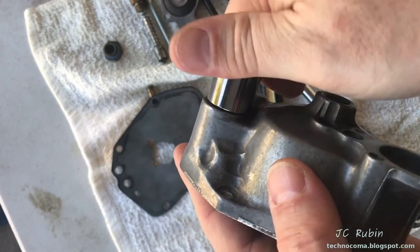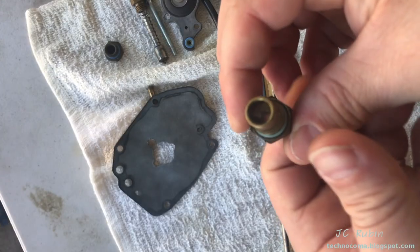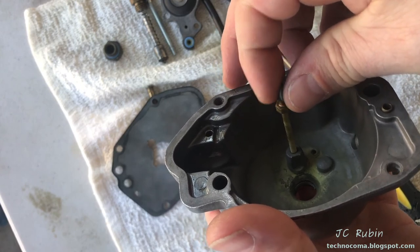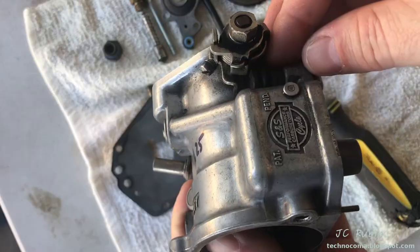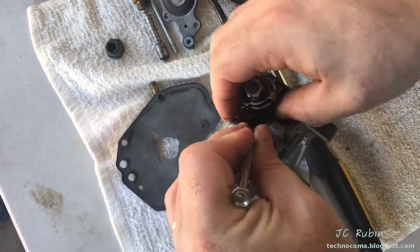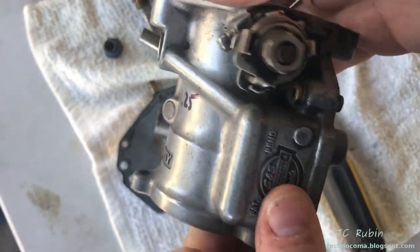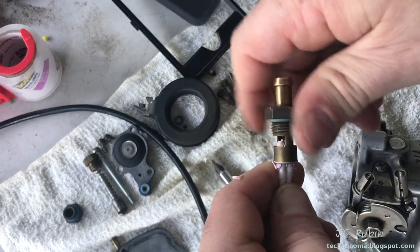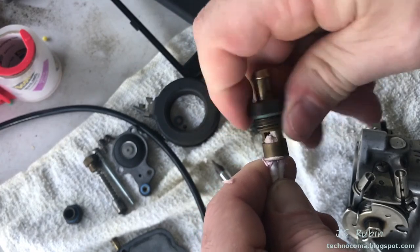I've already loosened this — 5/16th — it comes out like that. I'll be able to properly clean and inspect this and make sure it's okay. I'll polish the inside race anyway. On the bowl we have this one o-ring to take off. This piece is pressed in so there's no further breakdown on this unit — it's ready for cleaning. I also have to get this rubber piece removed over here and this o-ring, and I'll be cleaning up this face too. I'm going to remove this dust cap for the accelerator pump and that should be about it — ready for cleaning.